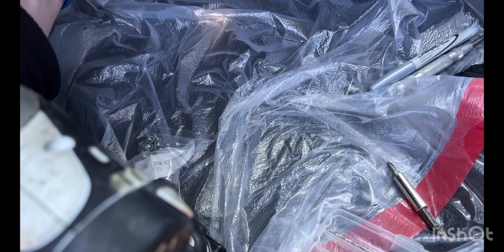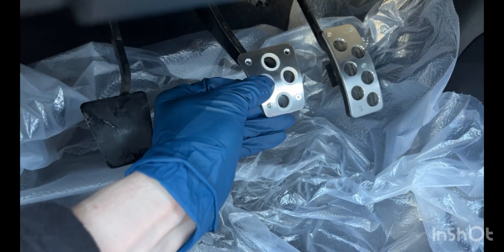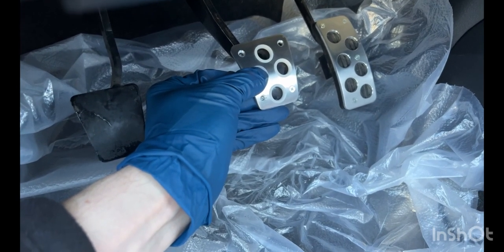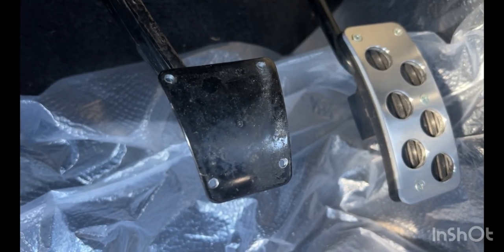And what I'm doing too is I have three different drill bits. So I'm starting off with the tiniest one first, then stepping up, and then stepping up. That way, it keeps the drill bit more aligned properly into the hole. And trying to drill into this hardened steel with just the large drill bit doesn't seem to be as easy. All right, all four holes are drilled.